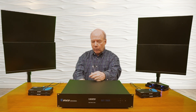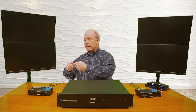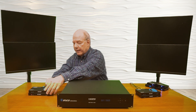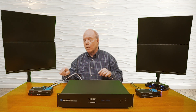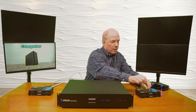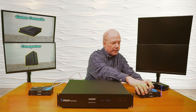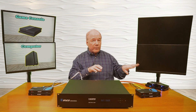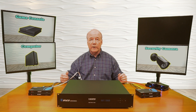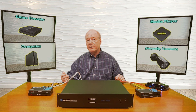Notice that on the remote receivers there are no lights on the front at this point. The moment the LAN cable is plugged in it provides power for that module to come to life and it starts an internal power-on self-test, checking the electronics and detecting the resolution of the monitors so the transmitter knows what type of content and resolution it can display. It takes a second or two to make that adjustment and perform the handshake, but the images from the media players will slowly appear — and remember, that receiver could be 300 feet away connected by just that single LAN cable.